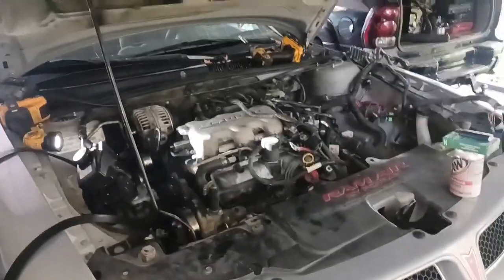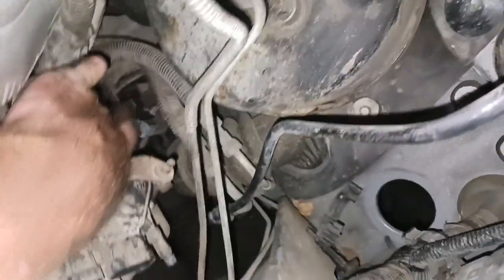Alright, starter is out - there's the bolts right there. I've got the computer all disconnected, harness is pulled through, everything's on top. Got the transmission all disconnected. I still have the rear O2 sensor to deal with, and I've got to get the fuel lines - the quick disconnect is already off the engine, so I just have to get those two fuel lines off right there with my fuel line tools. Now it's just torque converter to flex plate bolts and that engine mount.